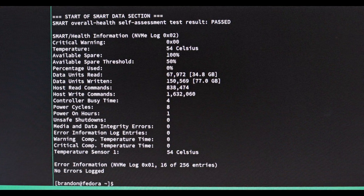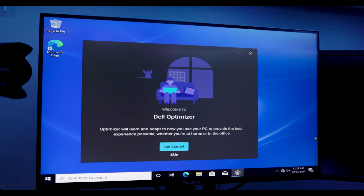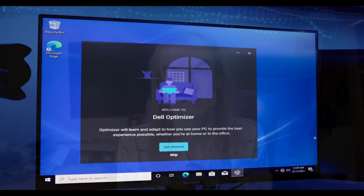Now on to what my plan with these drives is. Because I have a lot of nearly identical drives, I want to run a test I haven't seen anyone else do — an endurance test on basically identical drives. From looking at the SMART data, they seem essentially brand new. All of them report less than 100 gigs written. The data on the drives looks like a Dell OEM image, so my best guess is they came pre-installed in a Dell laptop or desktop, then an IT company replaced them with another model and never used these again. I tried booting one and it boots fine — just a copy of Windows 10 with Dell software. So these are essentially new drives, which is great for endurance testing.